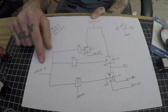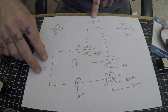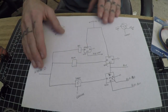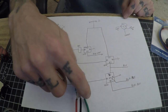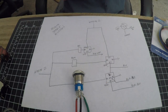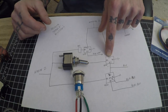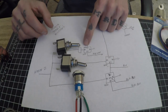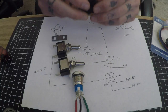The black with blue powers the starter and the solid blue powers the ignition itself — the coil pack, etc. The two white wires provide power to the key switch. First, obviously, disconnect the battery — you're working with constant 12-volt power and the main relay section, and you don't want to pop your main relay. One white wire I'm going to use to power the actual switches and the other to power the relays — switches are low current, relays are high current, so I can keep everything separated. The start button will have constant white power going to it, with the green wire going out to a single pole double throw (SPDT) relay — search eBay for SPDT — it has five prongs with 87a being the center prong. The run switch is going to power a single pole single throw (SPST) relay with four poles.